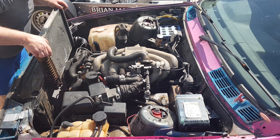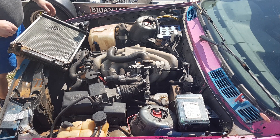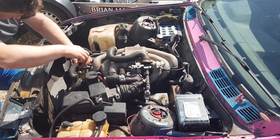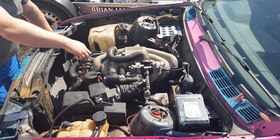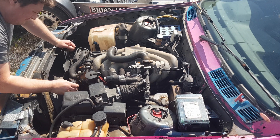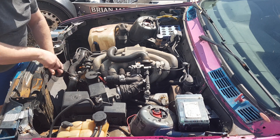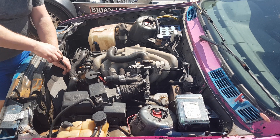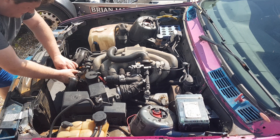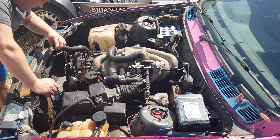What we're doing here is taking the radiator out, because it's pretty knackered. The old fan took chunks out of the thing — it's a standard radiator and we can do better. We can install a bigger radiator, replace some of those pipes because they are the original pipes. And if we're there, we might as well do the cam belt, because that's about four years old now. It was a pretty good time to do that — the water pump and the thermostat, you might as well. This was a bit scary for me; I've never done a cam belt before, but with a lot of back and forth looking at the E30 zone, I thought I'd give it a go.